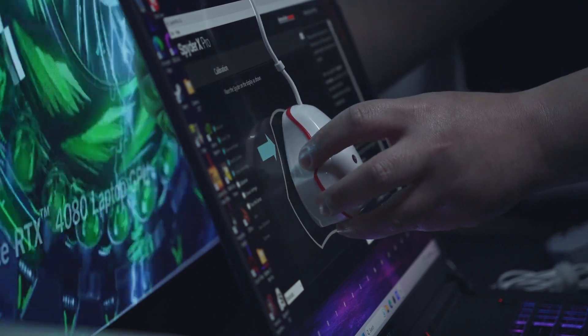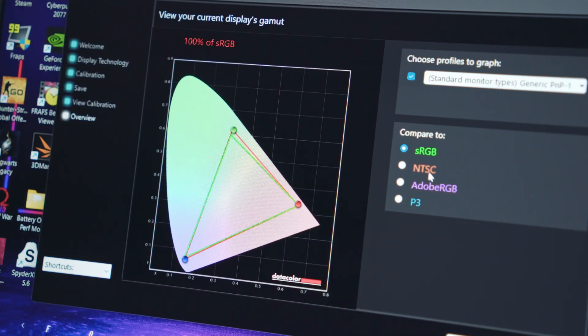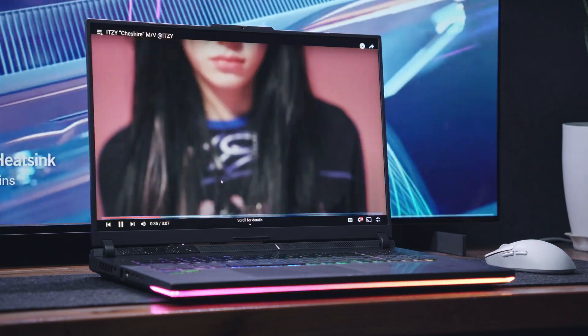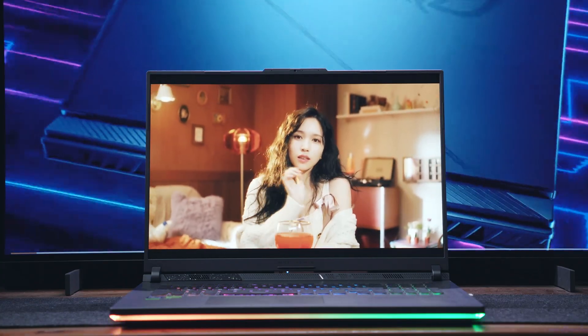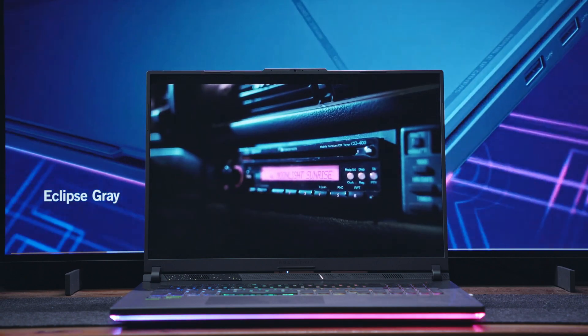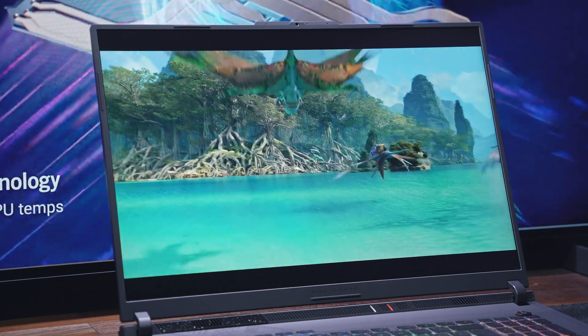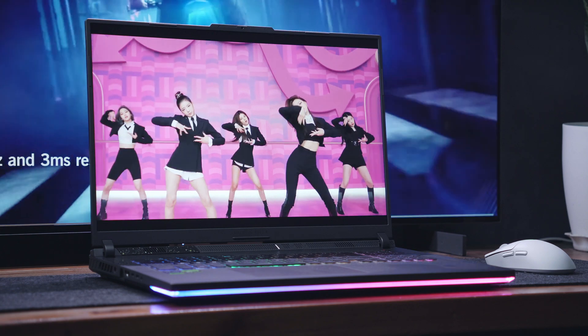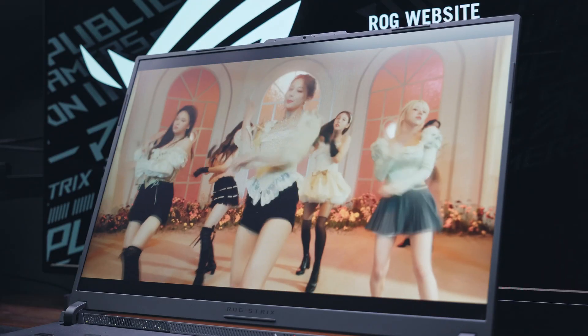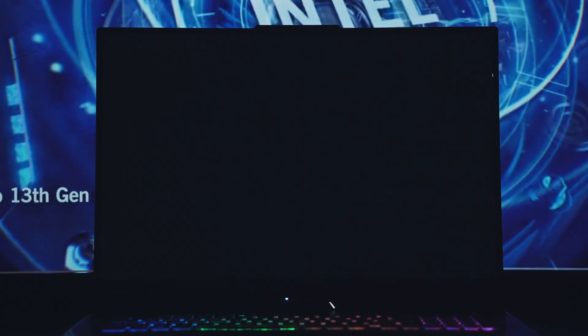Using a DataColor Spyder X Pro display calibration tool, the display on this laptop covers 100% sRGB color space, 71% NTSC, 77% Adobe RGB, and 77% P3. This means it should be good enough for most applications, though it depends on which color space you're working with and your particular use case — like social media and web posting or print. It's decent enough for social media, web applications, and casual video editing. The display also supports Dolby Vision HDR, with decent image quality showing good colors, contrast, and sharpness, along with good viewing angles. Brightness is rated at 500 nits, and it also has an anti-glare finish. There's no significant backlight bleeding, and there are no noticeable dark spots on a white background.